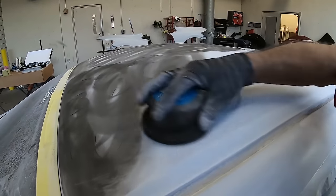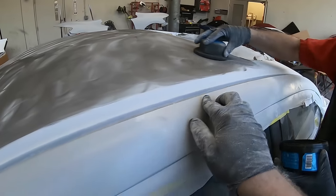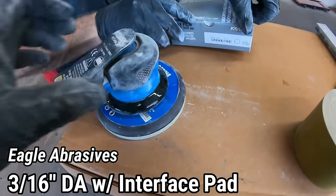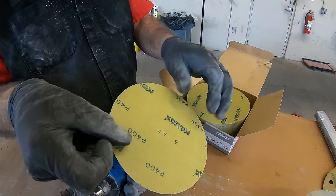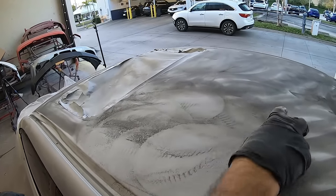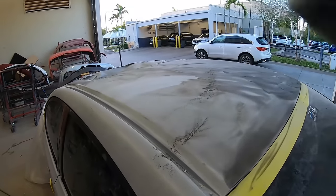Pedro is using circular motions, and what that ensures is that we're really getting into all of the scratches. You can see right here we have a little bit of a spot — this is a good guide to show us this area might need a little bit more love than other areas. We're going to be using our DA sander with an interface pad — I'll link everything in the description — and we have our P400 grit. Once we remove the guide coat, anything sanded now is a true P400 grit. If we had anything underneath, we would still go at it.